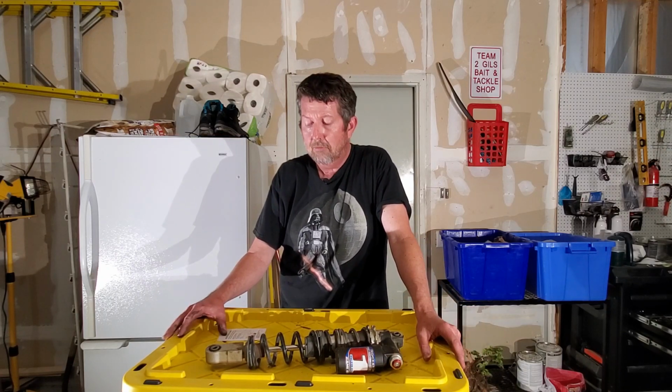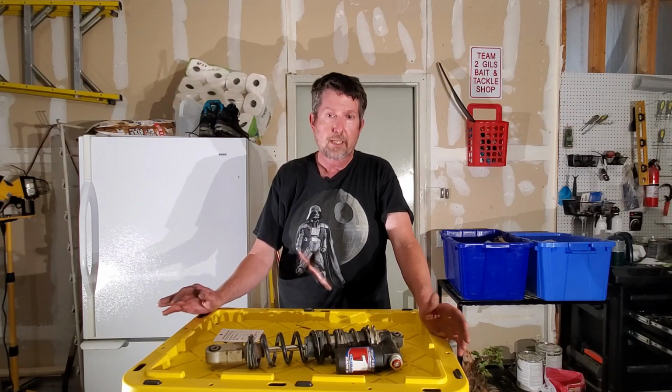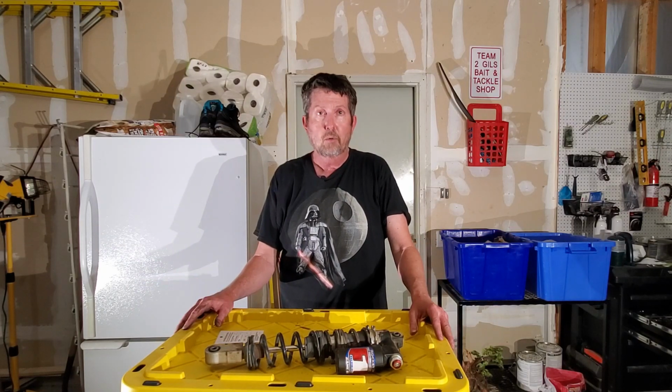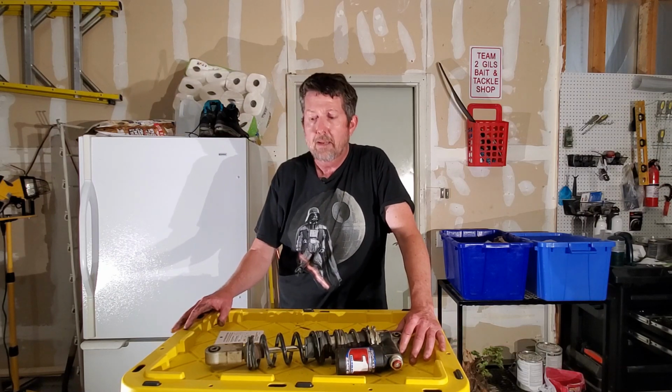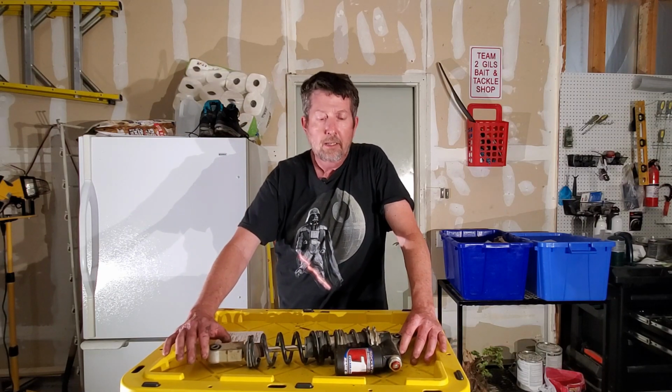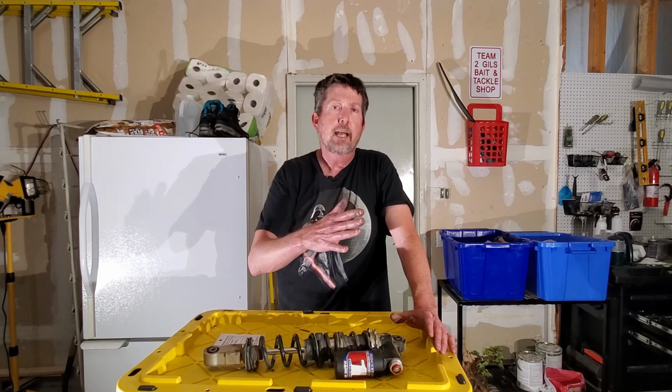So there's just a lot of different stuff there. But again, is it better A? Is it better B? You don't need any experience to do it. Again, if you get it completely screwed up, turn it right back to where you started and you're back to square one. As I mentioned earlier, do one setting at a time when you're adjusting your shocks. Don't make a shock adjustment and then adjust your camber or caster either. Do one thing at a time. Write down where you were, where you're going, and then test it.